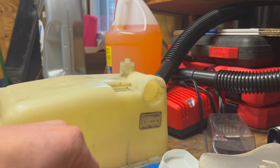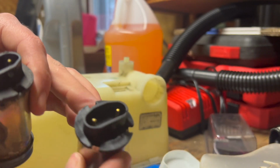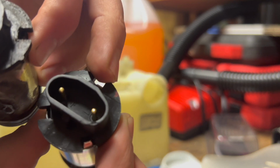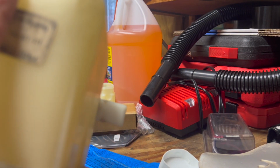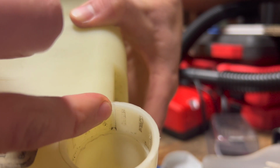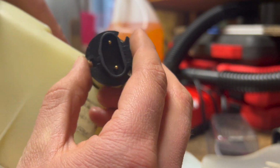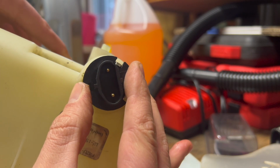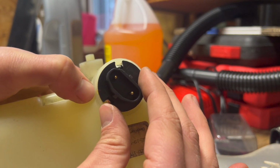The old one had a tab like I showed you earlier in the video. The new one does not. So I lined up the shape where the connector will plug in, and I put a little Sharpie mark right there to denote where that tab slides, because there's a cutout in the top of the fitting right there. I'll line that Sharpie mark up in there, and rotate it around so it can slide down to where that groove is. So I'll start pushing it down carefully, straight and even, making sure my Sharpie mark lines up with the cutout.